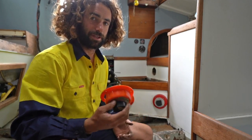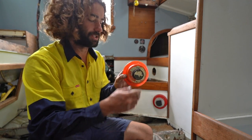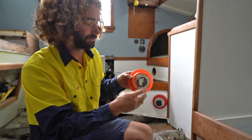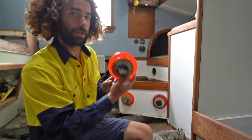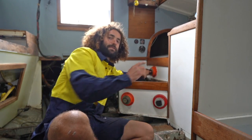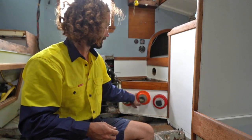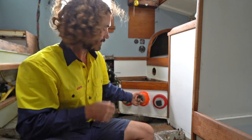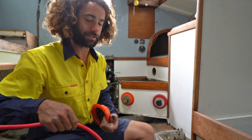While we're waiting for those enclosures to dry, I'm going to start hooking up all the wiring. The wiring is going to run to this switch — one bank will be on two, one bank will be on one, and then you can have the option of running off both or isolating them completely. This switch used to be up here because the auxiliary batteries used to be over there, but the battery banks I'm putting in are a fair bit bigger, so I'm going to move this switch down here so it's a bit closer. I've just got to drill a hole through here, mount this, and then start running the cables for the battery banks.